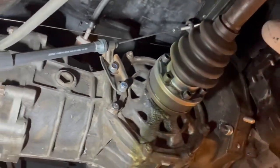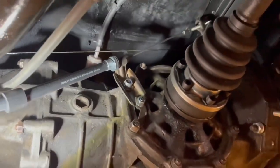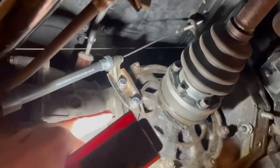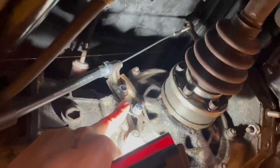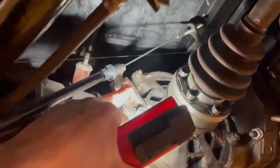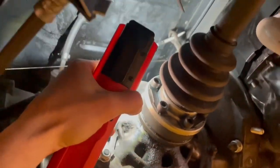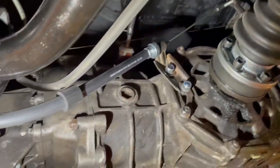To make a Type 1 VW transmission work, there is some customization needed. The clutch cable alignment is a bit different — this is a Type 2 clutch bracket and I just customized it to work with Type 1. The Type 1 bracket would sit way up here and not be long enough, but this is a stock cable from Type 2 and it works perfectly. You can keep your stock engine mount in the front and in the back and everything fits pretty good.